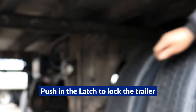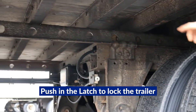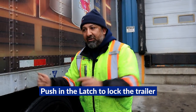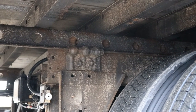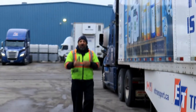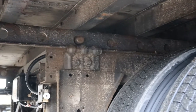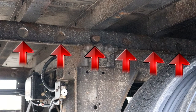Now to lock it, you just push in the pin. You don't see the pins come out. You go back into the truck and jiggle it — move it forward or back — and you'll see the pins lock back. That's all it took to move the axle. There's no pulling it hard or soft; it just very lightly pops back in. Now, as you can see, the axle is locked. You would count it and see how many pins you are, go back onto the scale and get a reweight if you have to push it back and forth.